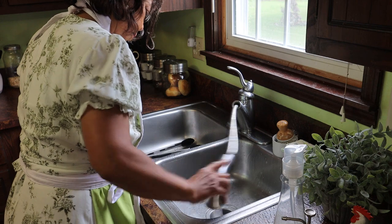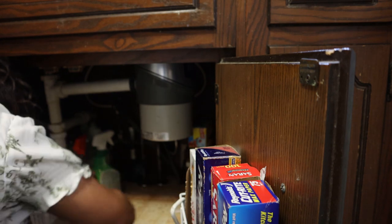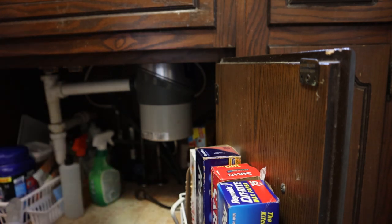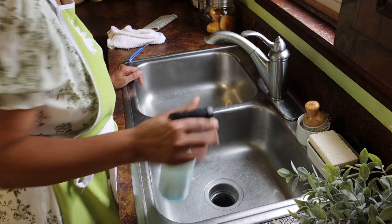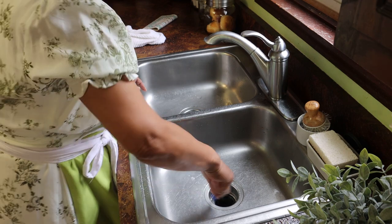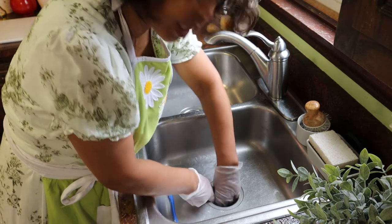I always like to look to see if there's anything in there. Once I turned it on I could just tell it sounded a little odd, so I'm glad I got whatever it was out. Now I'm going to get started cleaning it up. The first thing I'm going to do is unplug the garbage disposal — the last thing I want to do is injure myself while cleaning it. I've got a solution of one part Dawn dishwashing liquid, one part vinegar, and one part water, and I'm going to spray that down into the disposal to clean around the flange area. I always get some kind of buildup there, and this is one of the times I do like to wear gloves.